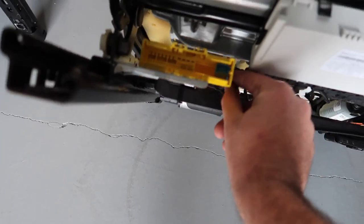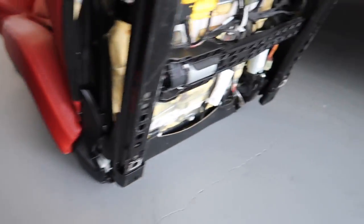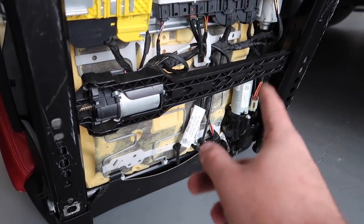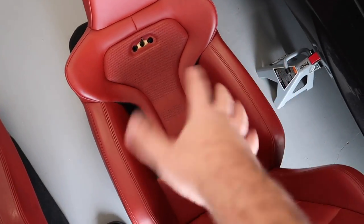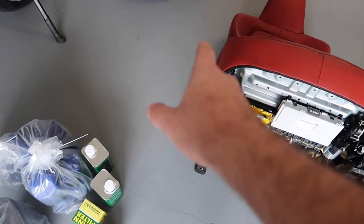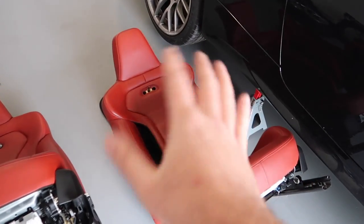There's one blue connector in here on mine, and two connectors on the new one — I think that's because the new seat is missing the seat buckle. We need to transfer the seat buckle over so we have both connectors. The new seat has a motor here, and thankfully it does have the heated seat option as well. It has two motors on each side facing the same direction with the same cables. Everything else looks exactly identical, so this is looking really good. Once we slap the seat in the car it should work exactly the same. At this point let's transfer the seat buckle, the carbon, and the emblem, then test it.